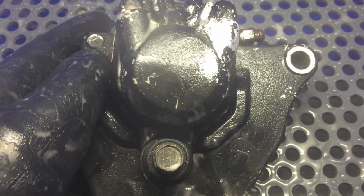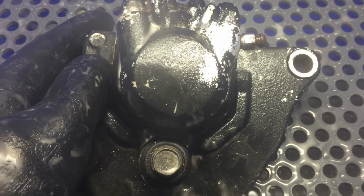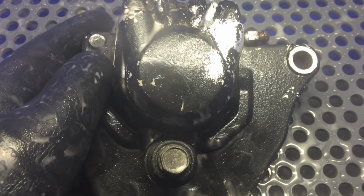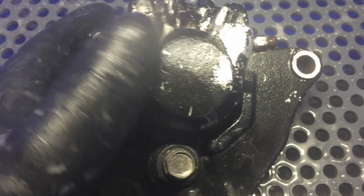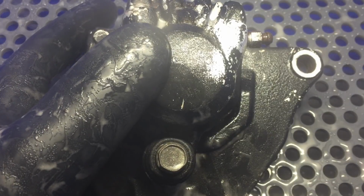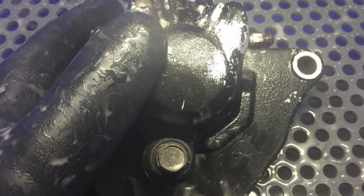Normally, if it's powder coat or paint, you're gonna have to use a very aggressive media such as aluminum oxide or garnet or crushed glass in a vapor honing cabinet. And today we're gonna be working with the fine mesh glass bead because we're looking to polish the part. At the same time, we're trying to remove this paint.